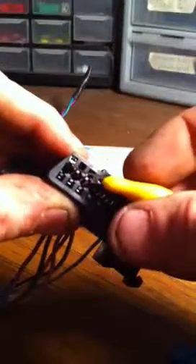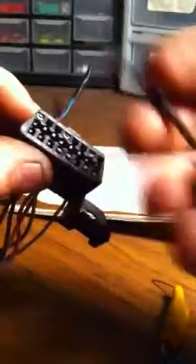We're going to go right underneath here and lift the tab using a pick. Lift the tab a little bit — you have to be really careful not to break these tabs, they are very sensitive. Find some way to lift the tab and hold it up while you're pulling the pin out. Push it back in, lift the tab, and it slides right out — and that's it.